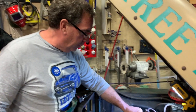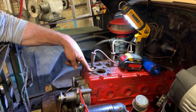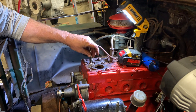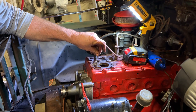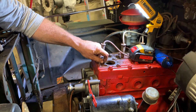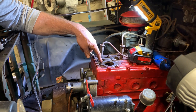Here's everybody's favorite thing — a broken-off bolt in a head, a flat head, on my '57 pickup truck. I'm going to flatten this out, use a 3/16 bit, drill right down through it, show how easy it can be — well, it's never easy, but we'll drill it right out through the center, then break out the rest of the pieces with a thread chaser.